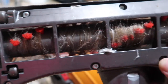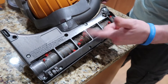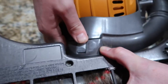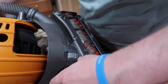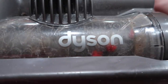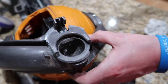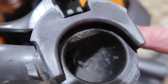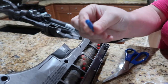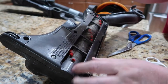We have five girls in this household, so there's a lot of hair in here — lots of long hair. This part can really get bound up and keep things very ineffective. Look at all that hair; it doesn't get scrubbed much because it's all bound up. So you release this and it slides off. For the tools: scissors for the bigger chunks, and a seam ripper, because it has an excellent sharp point and a blade in the middle. It just tears right through that hair.